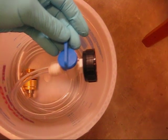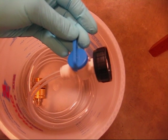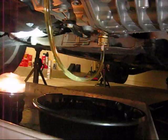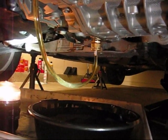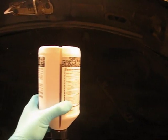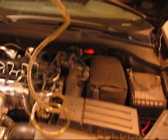You're basically trying to gravity feed fluid from above the transmission down through the bottom of the transmission. This takes a little bit of time. With a homemade setup, you'll need to puncture the top of the can to let air in. The bigger the hole, the faster it will feed. Just don't squeeze the bottle because you can make it leak from places you didn't mean for it to.